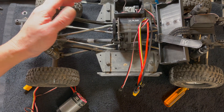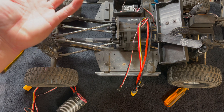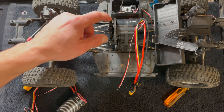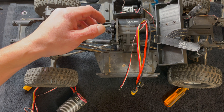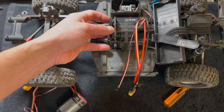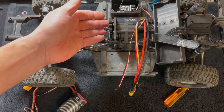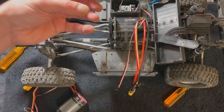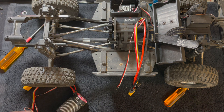When you do a new motor install, I've seen plenty of comments where people say it's really loud — but the motor itself really doesn't make any noise. If you take a motor and run it on the bench, it doesn't make any sounds. Any grindy gear sound usually comes from the pinion and spur gear being a little off from what it was with the previous motor. My general rule of thumb with gear mesh, especially in a crawler, is you want the least amount of play you can have while still having some play between the gears. The easy way to set gear mesh is to take a thin piece of paper — like a sales receipt or notebook paper — slide it between the gears, slide the motor in snug, roll the paper out, and that's about where you want to be.